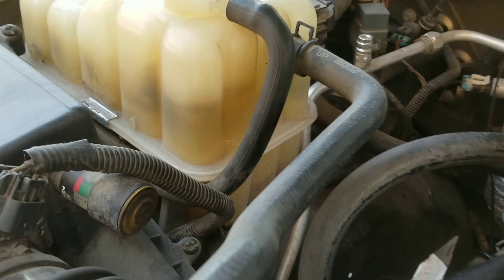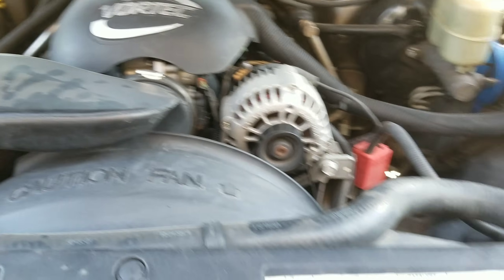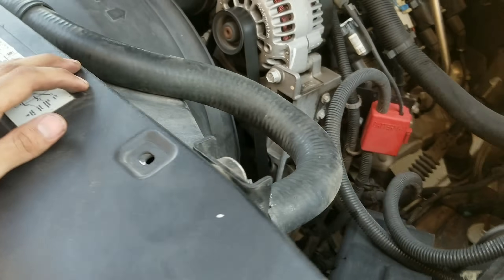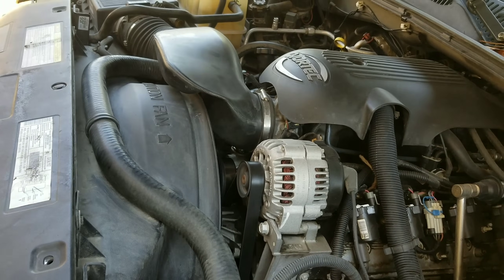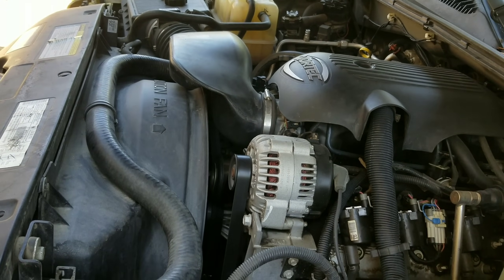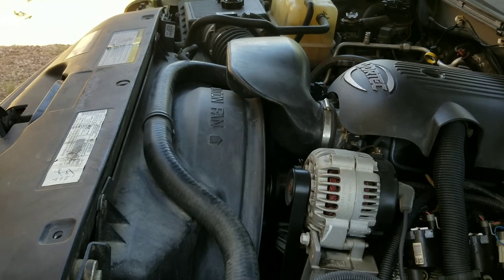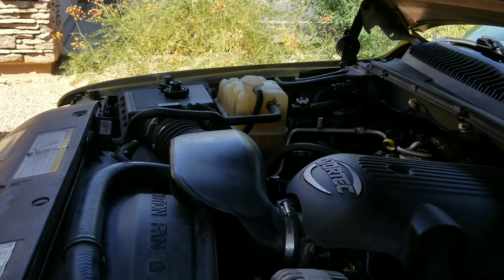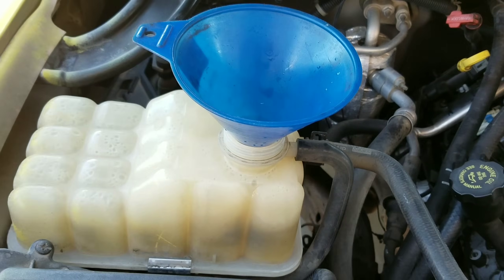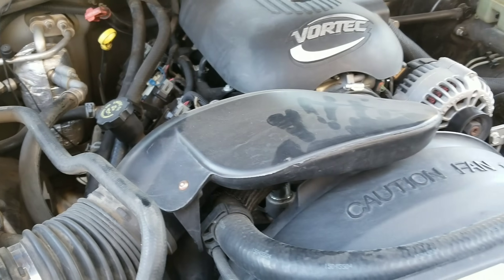With the vehicle on, most of the coolant drained from the reservoir. Now plug up the radiator and fill it up with tap water, then run the engine so the water circulates throughout the system. Then drain it again. We're going to do this about four to five times to remove all of the old coolant. Get a funnel and fill up the reservoir with tap water to flush the system.